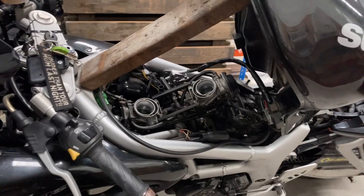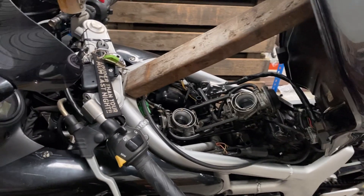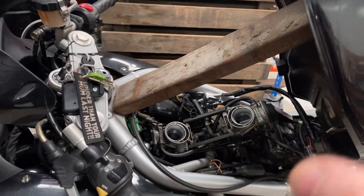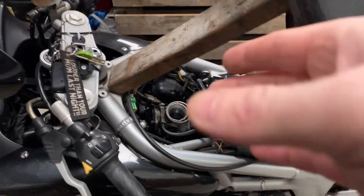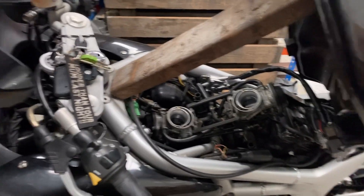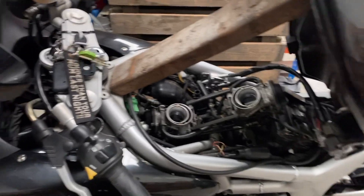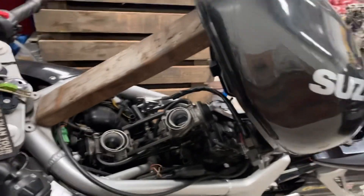Just a very quick video to help diagnose a fueling issue. You can hear the other cylinder kick in when we spray into the front carb — the revs just pick up on the one cylinder when it's just sprayed into the rear carb. By introducing a bit of fuel into that front cylinder, we can decipher whether you've got a fueling, spark, or compression issue. We must have spark and compression because when we introduce a bit of fuel it's igniting and the front cylinder is kicking in.